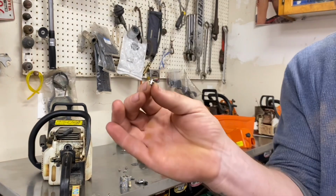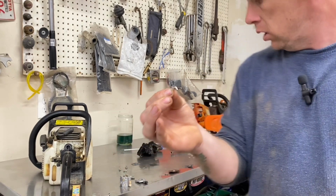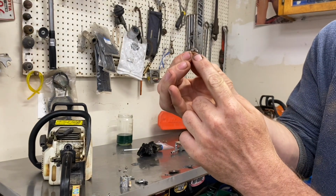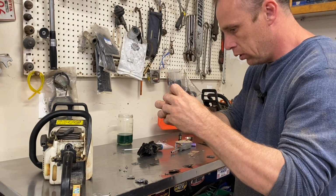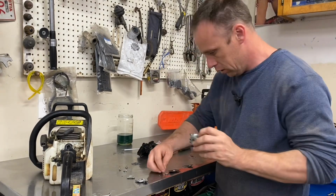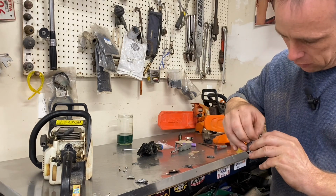These little needle valves, you don't even want to touch the tip of that, like a little fingerprint with some sawdust that you can't even see in it to make it leak. I usually pick up the needle with the metering arm, put my rocker arm in it. The way I'm holding my fingers, the spring sits on that little hole there. And you're carefully going to get that needle valve down in the hole, press down the spring. And you got this screw here, the short one, holds that rocker arm down.